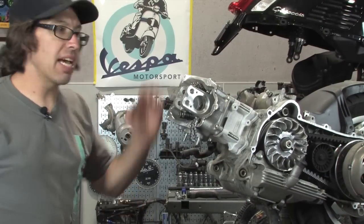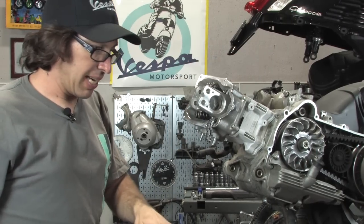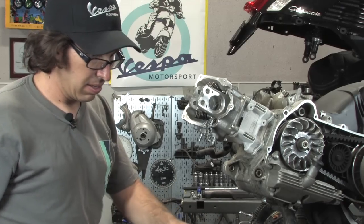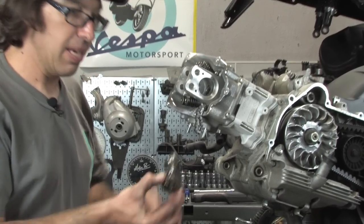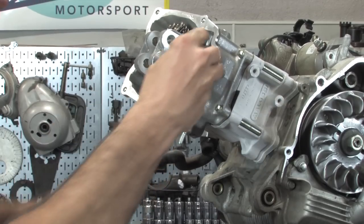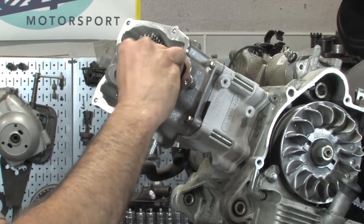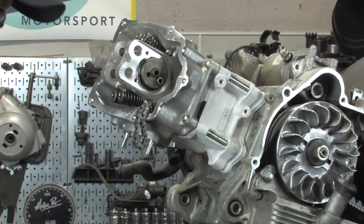We're gonna go ahead and put together the valve train, now that the cylinder head's all torqued. Got my cam. It's all lubricated with engine assembly lube. Same with the journals that the cam actually goes in. So gooey, I can't even hold on to it. You got the two lobes, and the lobes will face down when we slide it into the actual journals right here. So it's got to be perfectly square to drop in. So there you go, it's dropped in.